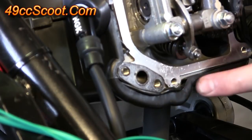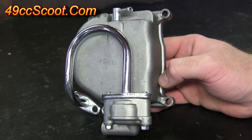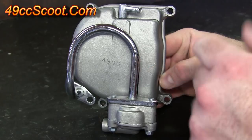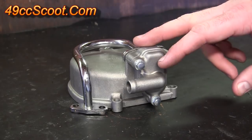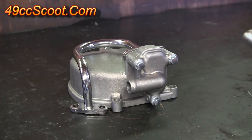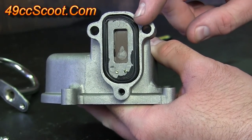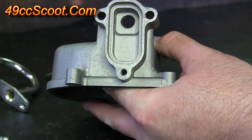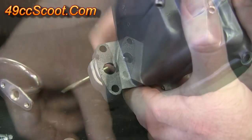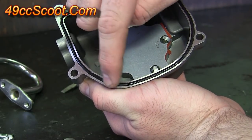You'll want to remove all the oil residue from the valve cover seating area and from the gasket. I want to remove as much of the PAIR system as I can from the valve cover to clean it up for future repairs. The easiest way would be to replace this with a non-emission style valve cover, then just bolt it back on. What I'm going to do is remove the tube and whatever components I can get rid of easily. Remove the three bolts — they're all eight millimeter hex head. With those out, the bottom pops off and the tube comes off the head. There's a reed valve assembly you can just pop out, and on the top there's a gasket you can pry off. Clean all the gasket material off, get it good and clean. Also clean the bottom of your valve cover and make sure the valve cover seal is in good condition.